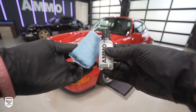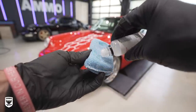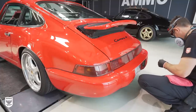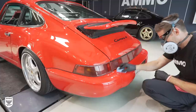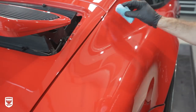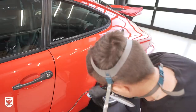With the car clean, dry, and with your PPE gear on, shake the bottle, then apply a few drops to the microfiber applicator pad — there's no need to actually soak it, just a few drops and you're good to go. Then immediately afterwards, lightly screw the cap back on to prolong the shelf life of the leftover product inside the bottle for future jobs, as each bottle will get you about two to three applications including the wheels and door jambs. Once primed, work in overlapping motions one panel at a time, and allow it to set up for about 20 to 30 seconds in most cases and sometimes longer in others.